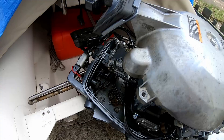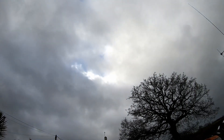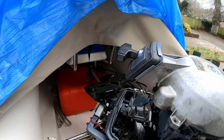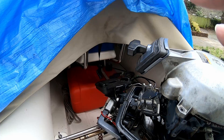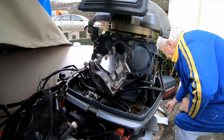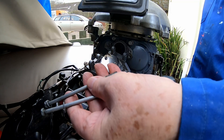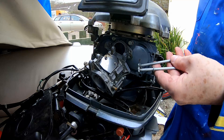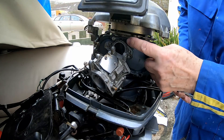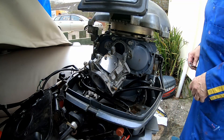We were promised fine weather today — supposed to be no rain — and we've already got drizzle, so another struggle on a nice winter's day. Next job is to fit the starter motor to the bracket. One of the many things I dislike are these two long screw bolts which go through the filter housing and actually hold the carburetor on. Any work you've got to do, particularly this bolt here which you can't get to because the air filter is in the way, necessitates loosening the carburetor.